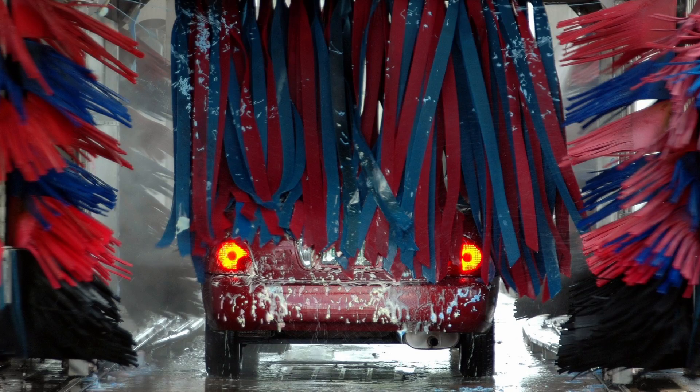Wax has got petroleum distillates in it, and that can damage the wrap on your car. It's also not a good idea to take your wrapped vehicle through a car wash unless it's a brushless one. The company that put your wrap on should advise you on that — if it has brushes, it can pick under the edges of the wrap and it will gradually come off.